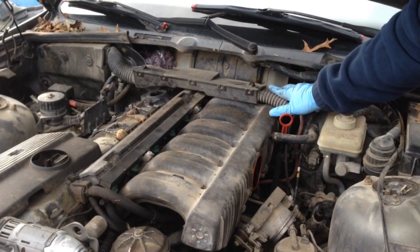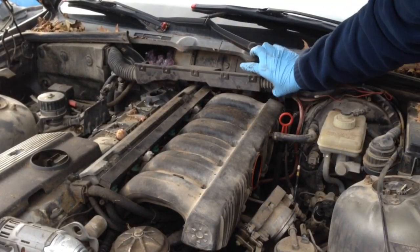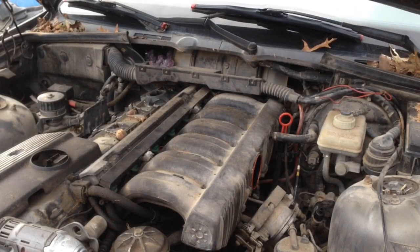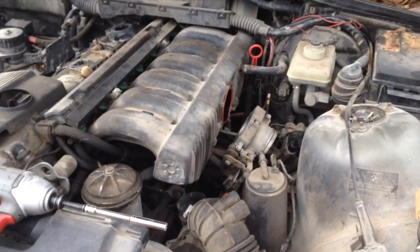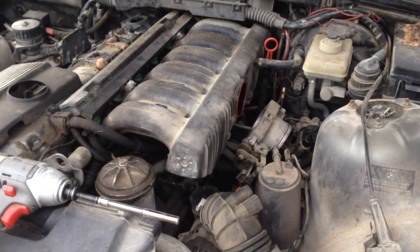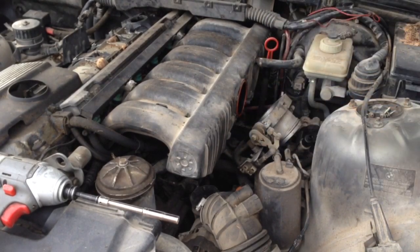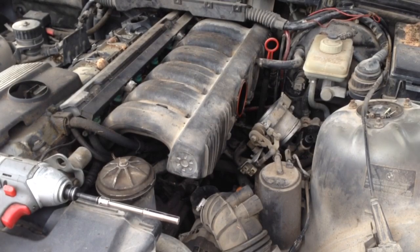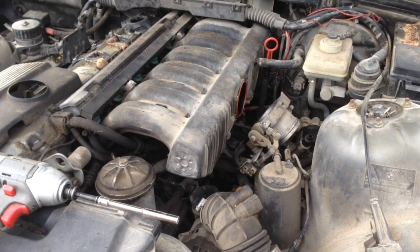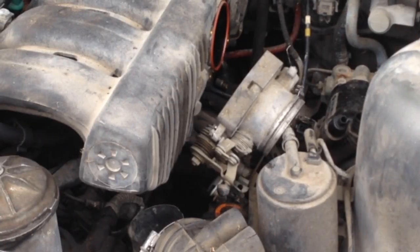That disposes our mouse nest and the whole works, and that should give us enough leeway to pull this manifold totally off. A little tip here: on these older cars take a little PB Blaster or WD-40 and go ahead and spray all the hose clamps. That'll save you a lot of grief disassembling this thing - they're going to be hard to turn if you don't. Having some extra hose clamps laying around is definitely not a bad thing.